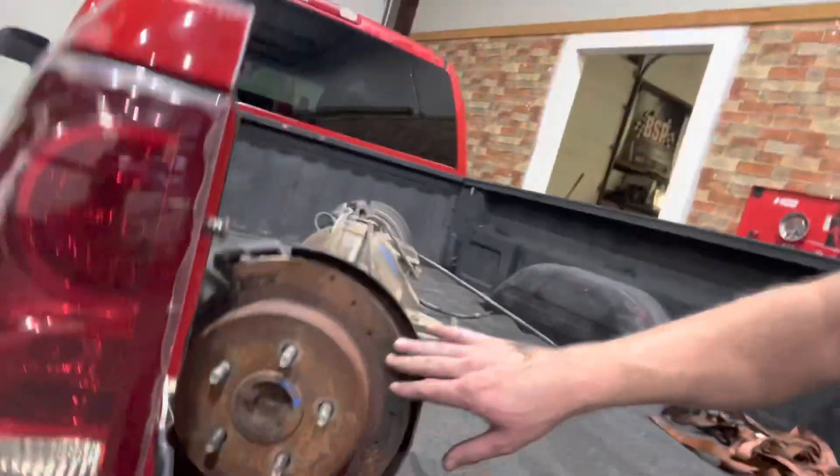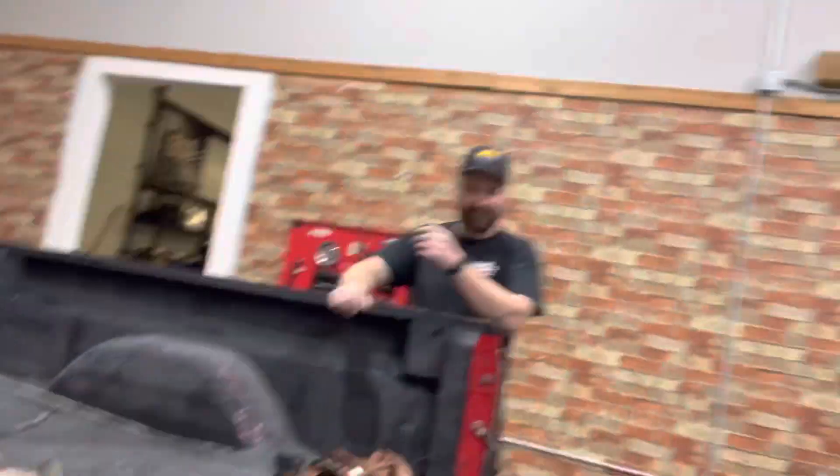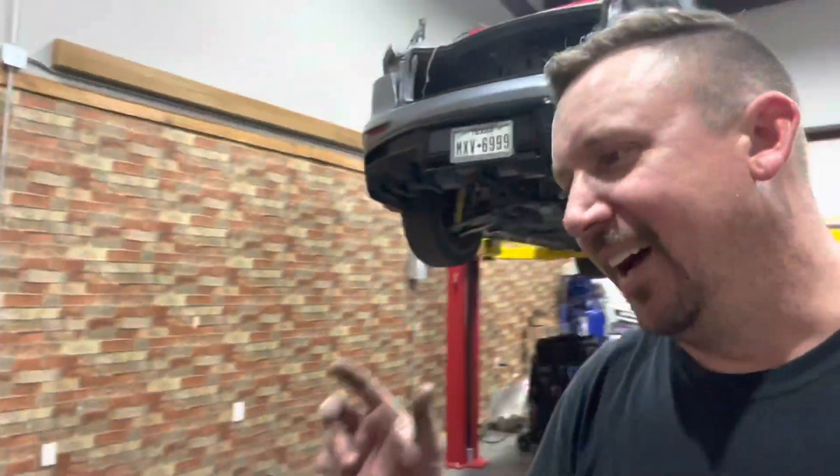This one came from the junkyard — we spent $150. It's a thing of beauty because we don't have any brake parts. We were thinking we'd have to buy a universal brake kit, which was several hundred dollars. But this one has brakes on it, even drilled rotors, which is a pretty sweet upgrade. On the tag you'll see we got 3, the letter L, 73 — and then 8.8 right there. So this one does have the limited slip.